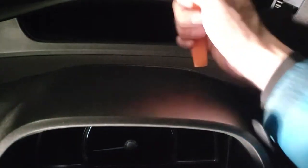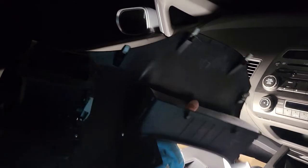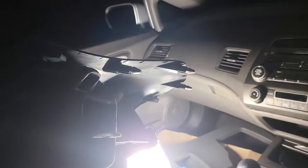Be careful and just pop the clips on the side, then this one comes up. Eventually you hold the plastic clip removal tool, push it toward the body in this direction, and the panel will come out. Unclip the white connector behind this section, and after that the panel will come out completely.